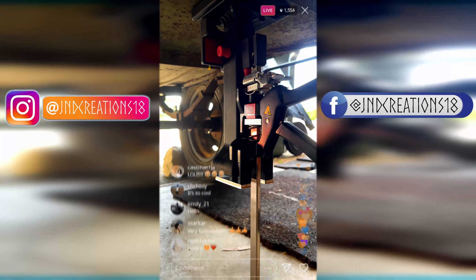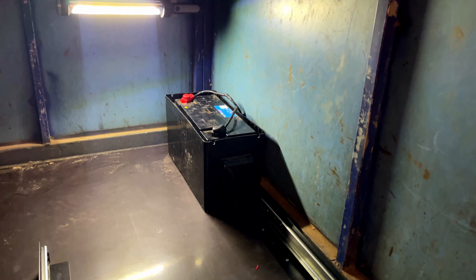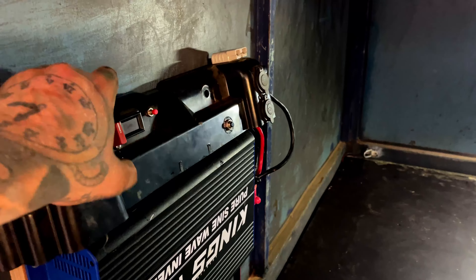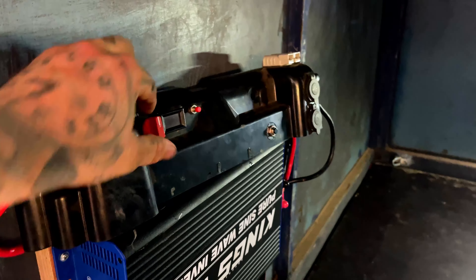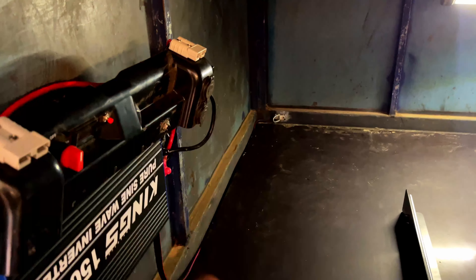It's probably not the intended use of Viking arms but using them as trailer stabilisers while you're working in there — they're doing a great job. I've mounted the battery in the back corner behind the fridge and run electrical cable all the way around the edge of the box up to the inverter. I'm going to glue this panel on so I don't have to spend extra money on another panel — this thing does everything I need: Anderson plugs, cigarette lighter sockets, and the inverter has a plug where I just run a power board out of. I'll just hot glue that in place. I didn't want to show the electrical work in the video because I don't really know what I'm doing — if you know a good auto electrics channel let me know. I've got the basics; it's not pretty but it's going to work.